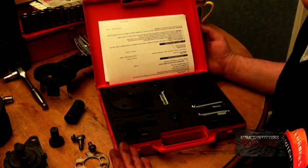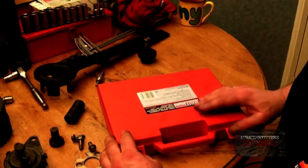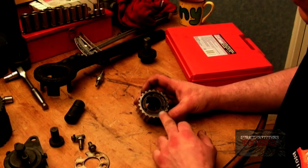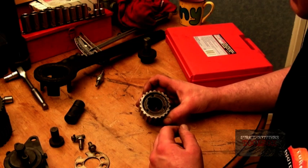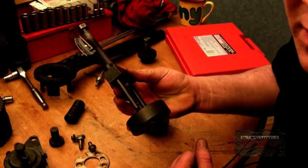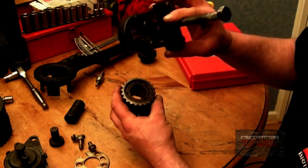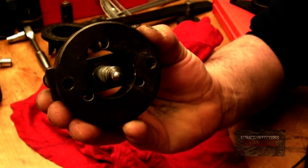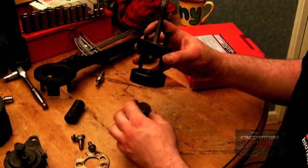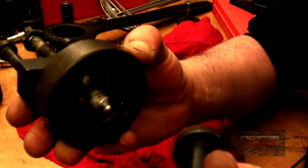That's where this kit actually stops — there's not enough stuff here. I've borrowed a few extra tools, so we'll have a look at them. Firstly, this is the crank timing pulley, which can be a bit of an arse to remove. What Land Rover came up with is this tool — it's a dual-purpose one. You've got three bolt holes here which are M5, corresponding holes on this tool, plus a keyway for the keyway on the crank. They bolt on there and you also need to chuck this one in so you don't damage the threads, then screw it to pull this part off.